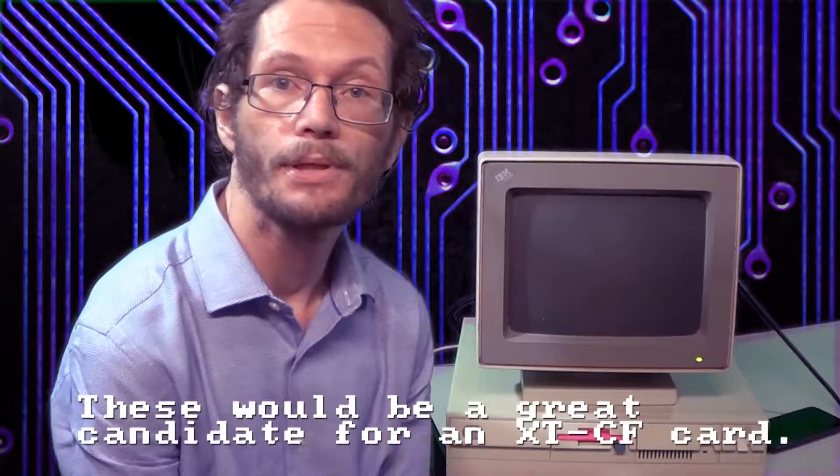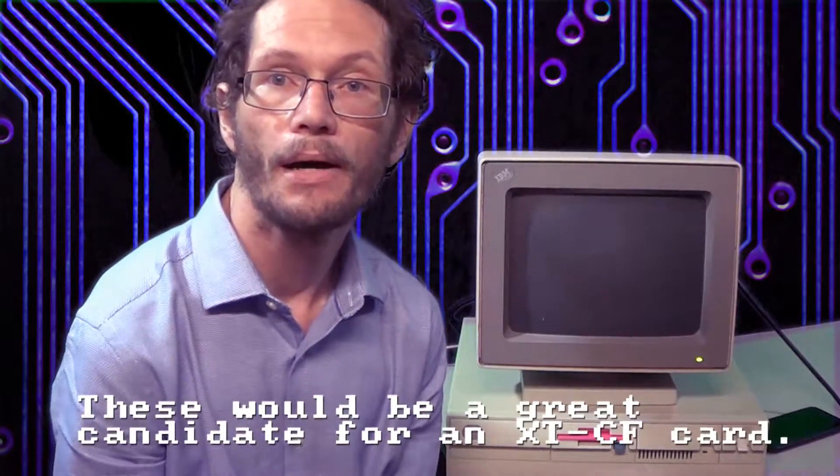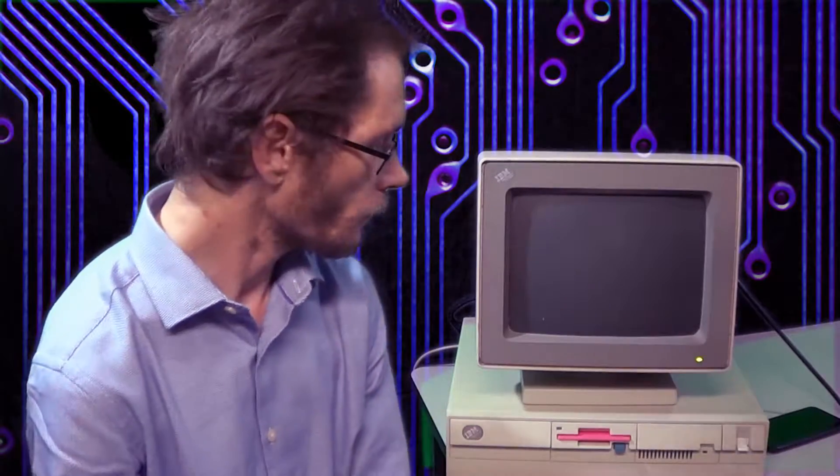Actually, talking about the machine — the not going yellow is about the only positive thing I have to say. The hard drive in it is sluggish and proprietary. The floppy drive is standard but proprietary. The power supply is also non-standard, although it uses standard voltages and it's a decent size — it's just proprietary, and it doesn't have any Molex connectors, which makes adding hard drives very difficult. It's also got one of these Dallas real-time clock modules, so for it to keep settings like time, date, and hard drive settings, you're going to need to hack this. My solution is to hack into these and put your own battery module in them, so you don't have to deal with it later.